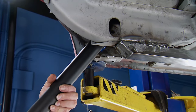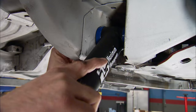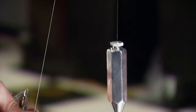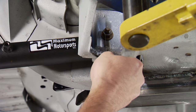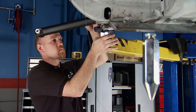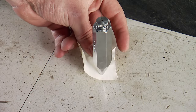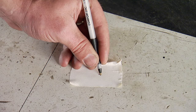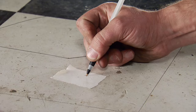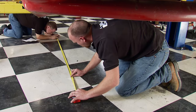That will require a point of reference at the rear of the car as well, so the lower control arms will be put up with a bolt through them. Using fishing line and four plumb bobs, we'll hang one on each side of the K-member just below where the control arms mount, and two more off the rear lower control arm bolts. We lower the car to get the plumb bobs close to the ground, then place a small piece of tape under each bob and mark it with the point, placing an X over the hole for a good visual. Same goes for both sides on the rear. Now base measurements are taken front to back to check the wheelbase, and diagonally.